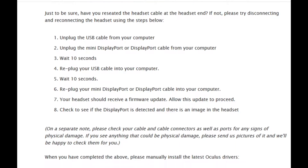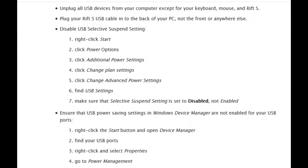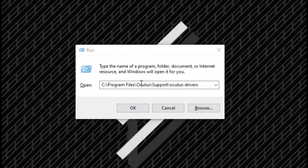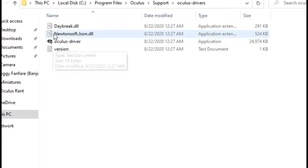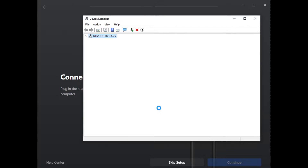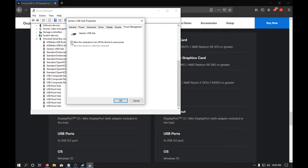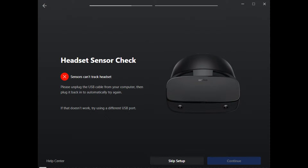What the hell? The next day I got another email from Oculus. They gave me a whole list of things to try, most of which I'd already tried from the forums. So I went through and tried the new ones: unplugging everything and plugging it back in — didn't work. They told me to run the Oculus Drivers program, which is supposed to update your Oculus drivers, but it actually brought me back to the first problem, so there I go again into Device Manager. I tried unplugging my secondary screen and any other non-essential USB device, and I tried telling Windows not to turn off USB devices to save power. None of this worked, so they had me send them log files to analyze the issue, along with screenshots of the problems for context. This means I have to wait another day for a response.